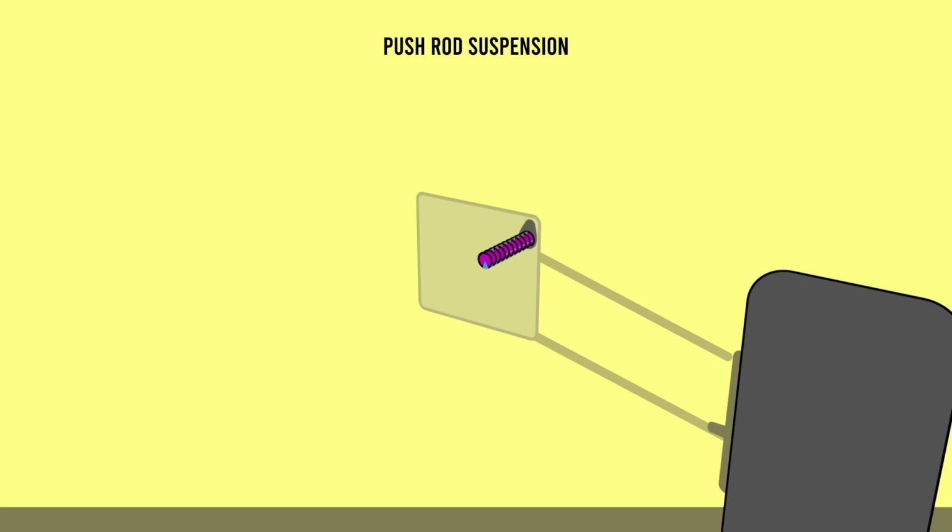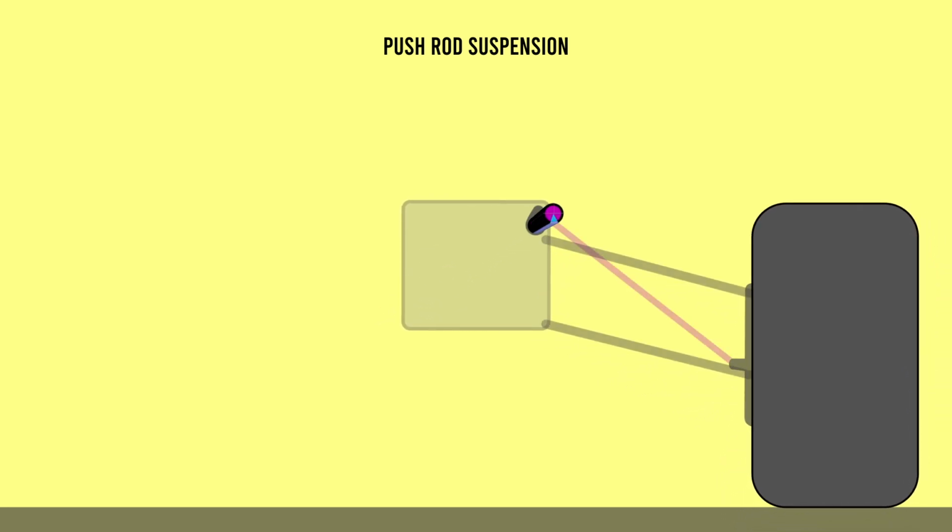The other end is fixed rigidly to the chassis, so it doesn't rotate at all. As the pushrod rotates the rocker, it forces the torsion bar to twist, something the torsion bar will resist. And when released, the torsion bar snaps back to its original shape. So functionally, it's identical to a spring in how it absorbs and releases energy, but is lighter, smaller, and more flexibly packaged. So this here is your very basic suspension setup so far.